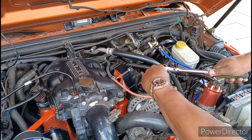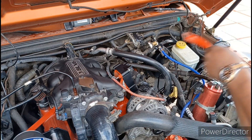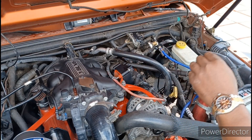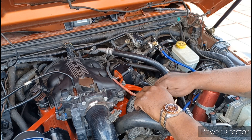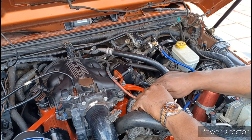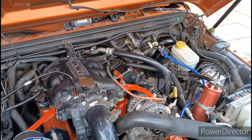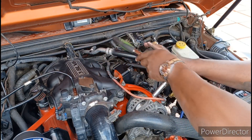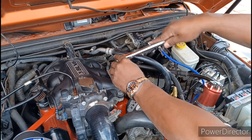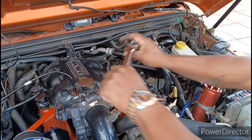Like I said, that's my 12 millimeter — you don't want to tighten it too hard, just snug it on there. You don't need a lot of torque for that because you'll end up snapping the plastic. Now let's drop my bracket back on — the back end has the nut and the front end has the bolt. These are 13 millimeters again. I don't really hammer down on stuff — I torque it tight enough. It's probably about 15 foot-pounds, it's not that tight at all.